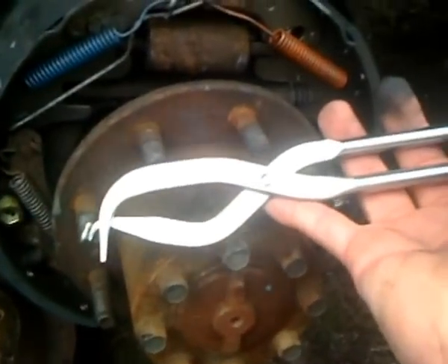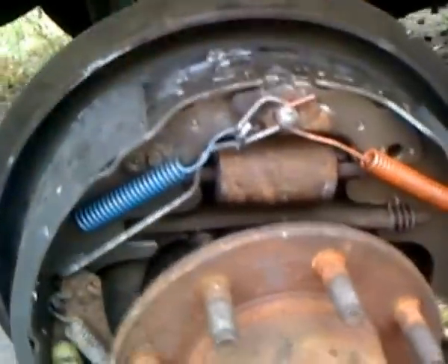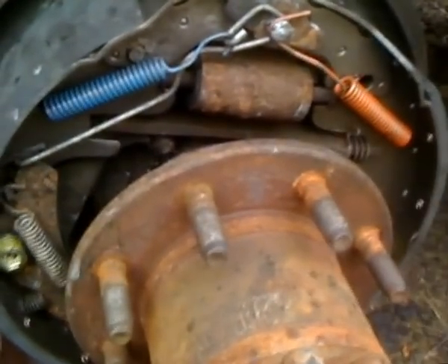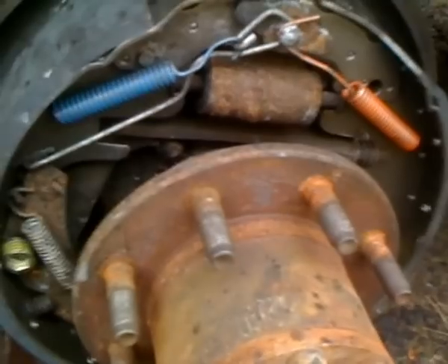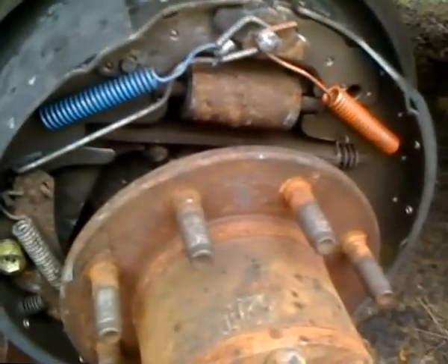Out of the tools I've used, they have one that looks like a screwdriver handle with attachments out of each end. I'll tell you, the extra length of the handle gave me some leverage when it comes time to put the springs back on. Unless you're a super body lifter, these things are strong. Now all I've got to do is just button it back up and make my adjustments for my parking brake. Back up a few times, apply the brakes firm — the adjuster should kick in and finish it up.